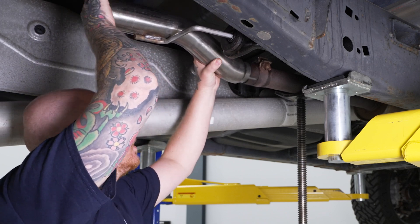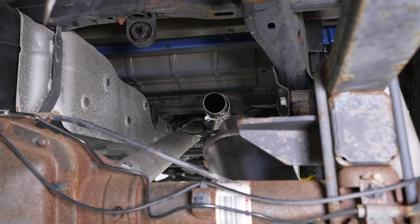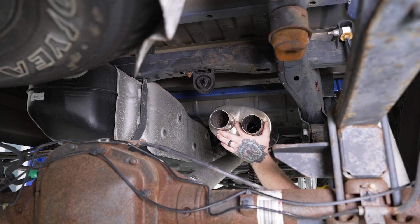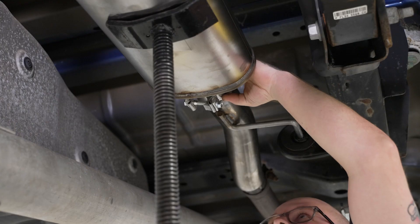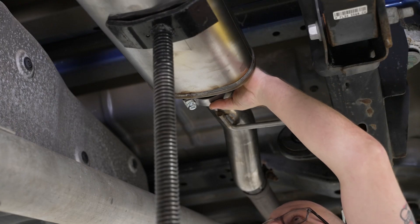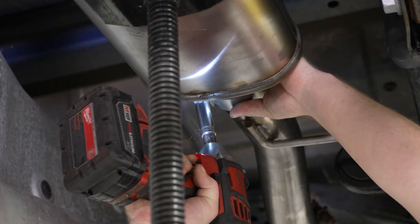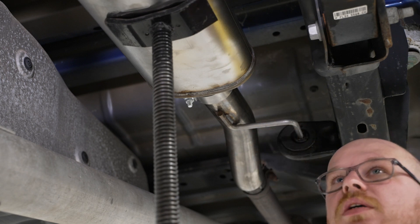Go ahead and seat that into place. Next, we can go ahead and get our muffler into place and we've got our pole jack here to lend an extra hand. We're going to grab our 3-inch clamp, slide that onto our link pipe, and get our muffler into place. We'll use our pole jack to get our height where we want it. Then I'm going to snug down our muffler inlet clamp just a little bit using our 14 millimeter socket — not going all the way tight yet, it still needs room to wiggle in case we need to make any adjustments.